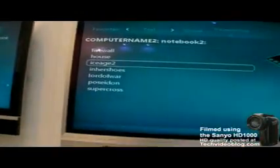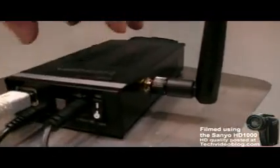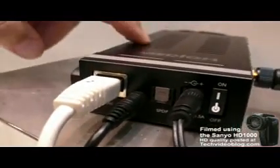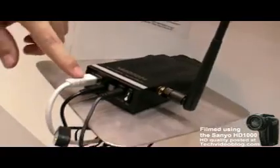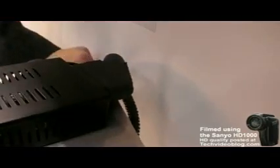Built into the TV, there is something in there? Exactly. What's in that TV is that little box — not with a separate case, but the same design. This box connects on one side to the local network, either using Ethernet or wireless LAN, G or N standard, and on the other side it just connects to the TV using the European SCART cable — or HDMI for different markets. That chip goes up to 720p, and we have a second chip going up to 1080i or 1080p. It's Philips Semiconductors, today called NXP. All the boxes run Windows CE5 and the NXP chips.